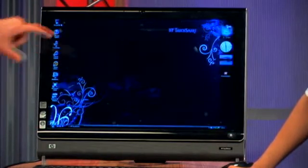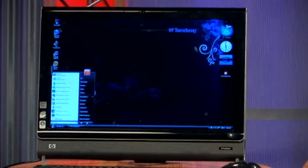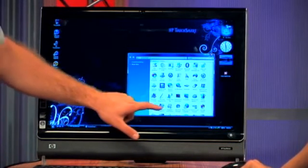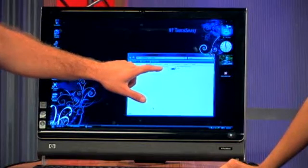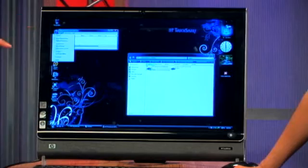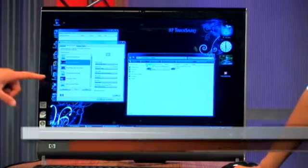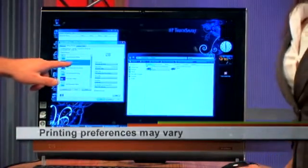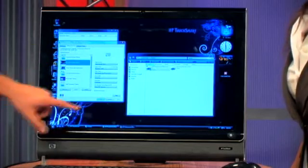I will show you guys how to choose either 8.5x11 or 4x6 for your photos. So let's go to the Home button and then back to the Windows icon. I'm going to press the Start button in the lower left corner and go to Control Panel. I'm viewing the Control Panel in Classic View. I'm going to find the printer — there it is. I double click that, then the HP Photosmart D7200 series — that's what I want. Up here it says Printer on the top row. I'm going to go to Printing Preferences. On the Printing Preferences, you'll see General Everyday Printing which is 8.5x11, and Photo Printing Borderless which is your 4x6. I'm going to highlight that and press OK — that way it will access the 4x6 tray.